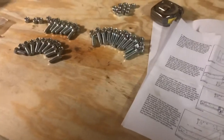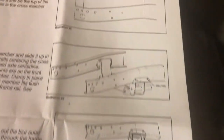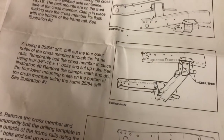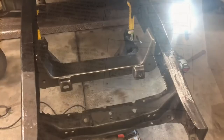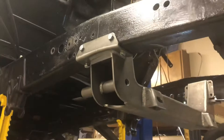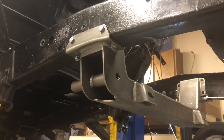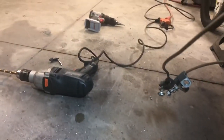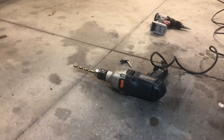That takes care of step six. Step seven is to go underneath and drill out the two bottom holes using the same 25/64 inch bit. That was a pain, but all four are now drilled out and set up with the bolts and setup nuts. Make sure you have decent sharp bits - I ended up using a step bit and then the 25/64 inch drill bit.